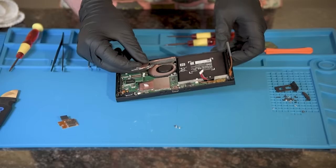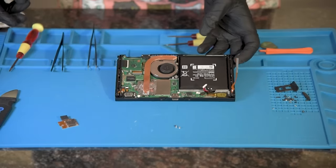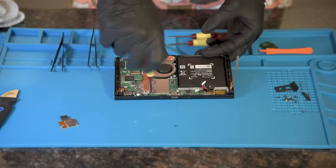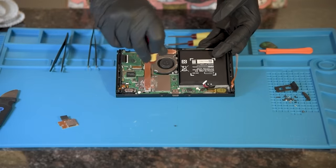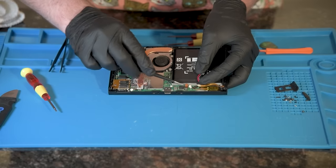Start by fitting the radiator portion in the slot next to the fan. Start with the leftmost screw hole and move to the other two. Only screw down to where it is barely tight on the heatsink first. Then you can go back and tighten them all the way.